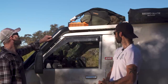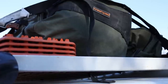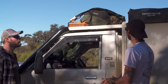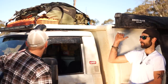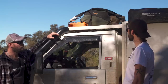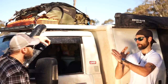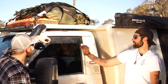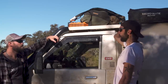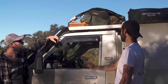The roof rack is overhanging, with Max Trax, an old crash pad, and an old crusty stretcher up there. A lot of the time I have a boat or a big kayak on there as well, so I've got a couple of racks up there and it just lets everything stay well forward. The whole reason this floats over the cab is because with a ute you get a lot of independent movement between the tray and the body. The rack actually mounts through into the dog box and goes a fair way back in, so there's heaps of bearing inside there — it can move just a little bit so it doesn't crack, and there's heaps of loadability.